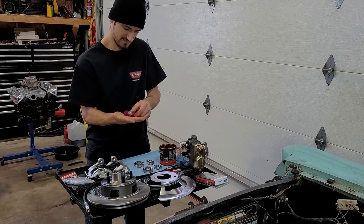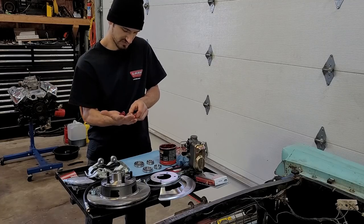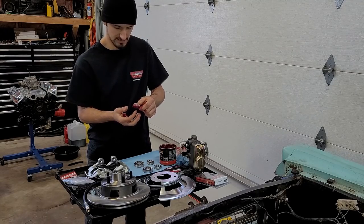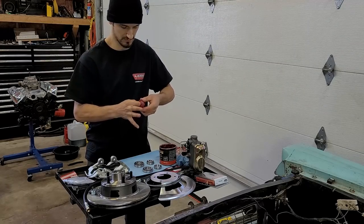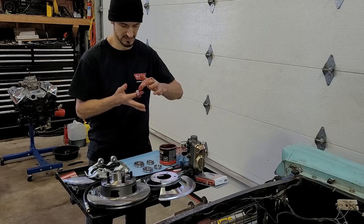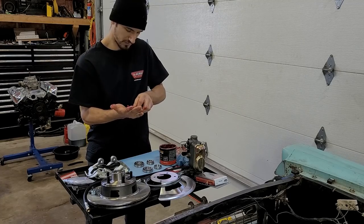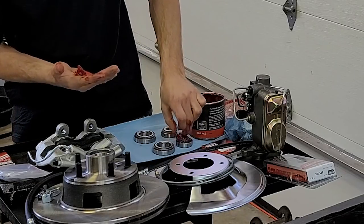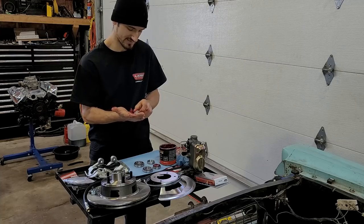Just slowly work your way around, forcing the grease in until it pops out the top. Once that's done, I like to give it a good little spin — possibly another repack just to make sure. Coat the outside of the bearings in some grease as well and then get it installed. Give it a good spin, coat the outer bearings, making sure everything has a nice healthy coating of grease. If you want to double check, just give it another quick little pack. It'll be good to go — just plop it back in the bearing race and get on to the next one. Don't bother cleaning your hands until you're all done.